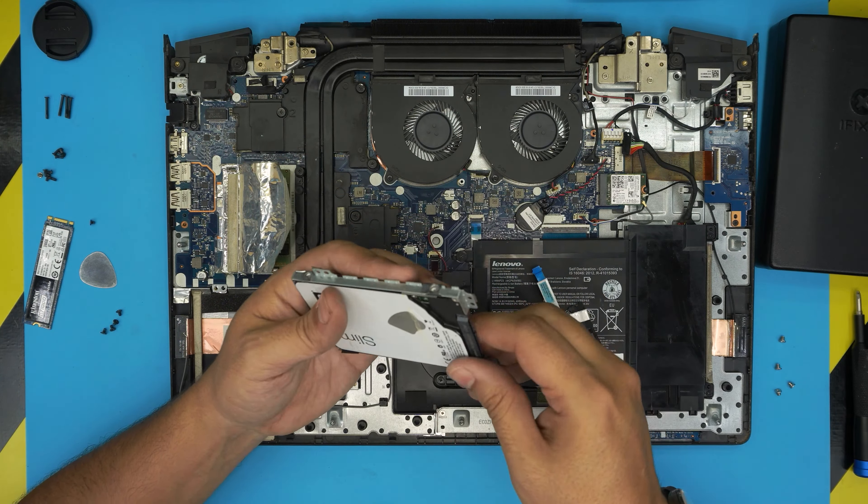Put the adapter on top and put the screws back in. I'm going to turn on the laptop once I finish so you can see it detects the hard drives. This is very important: when inserting the flex cable for the hard drive, it has little earlobes on the sides — it will not go in straight. You have to bring it down at 45 degrees into the jack, then push it down and lock it. To insert the M.2 drive, slide it in at 10 degrees all the way toward the jack, bring it down, make sure the screw hole matches, and put in the single screw. If you disconnected the battery, plug it back in and put the four screws for the hard drive caddy.